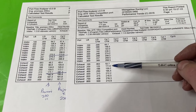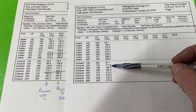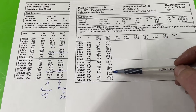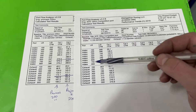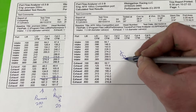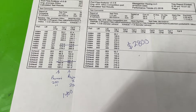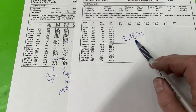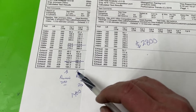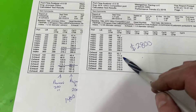On the exhaust, this is not even the same ballpark — AFR just kicks it, beats it bad. Almost 14 CFM better at one lift point, dang near 20 CFM at another, and getting into ridiculous territory at the higher lifts. So the exhaust port on the AFR 195 is so much better than the Project X. The intake ports are relatively close. However, the AFR head is $2,800 and this head is $1,400 — about a $1,400 difference. AFRs also have 8mm valves and a smaller diameter valve spring, so this one is more likely to go into valve float far before the AFR will. Flow-wise, they're close on intake but definitely not on exhaust.